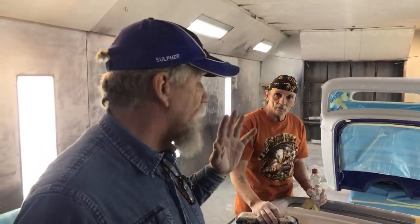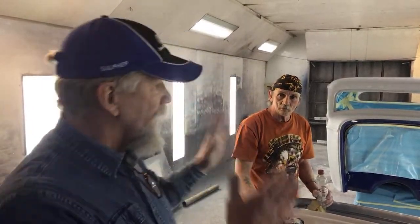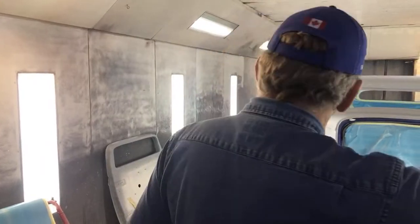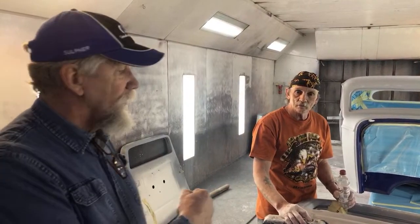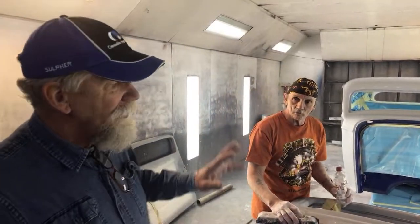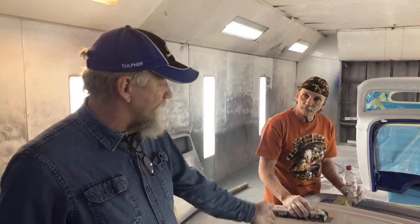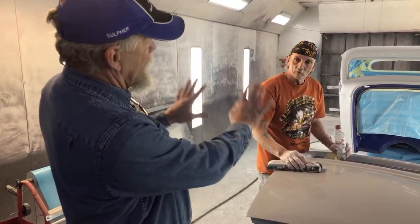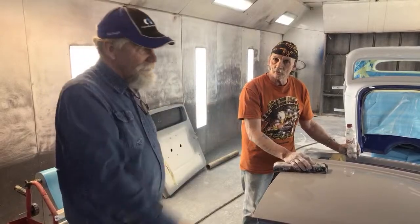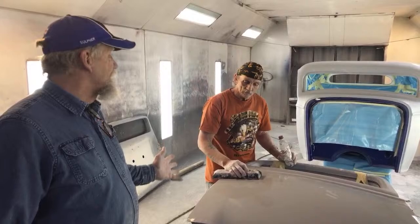Solid color is just going to be blue or black or white or whatever color it is. But the silver, you've got the metallic, and you've got two issues too on color match. If you're looking at the car, the face, everything is going to look one color. But if I paint this door off and then I paint the body separate, potentially, if your pressure is different, if you sprayed this direction or didn't overlap the same or you just didn't do it exactly the same, the color could be different from this part of the panel to this one. And it could be different in two different ways. Your face could be one color, but then your flop. So if I'm looking at this thing from the side, that gives you a different dimension into the way you're looking into the paint. I didn't mean to complicate it too much, but all that being said, we're going to put it together.